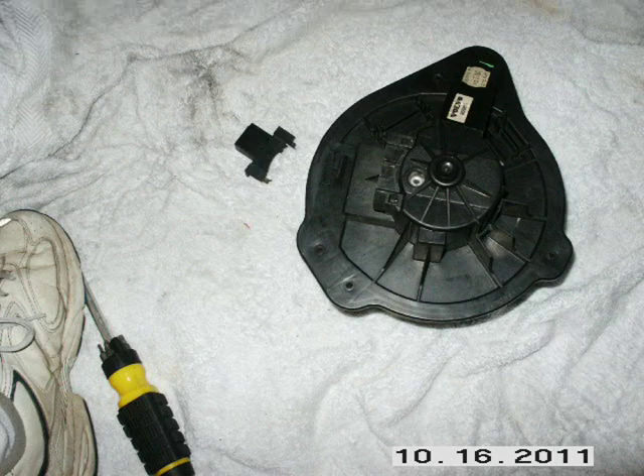The reason the motor was squeaking is because the bearings needed to be lubed. They start squeaking because they've gone dry. Failure is soon to follow, but it can be avoided or at least delayed if you lube the motor. The motor costs about $170, so I think it's worth the hour it takes to remove it and lube it.